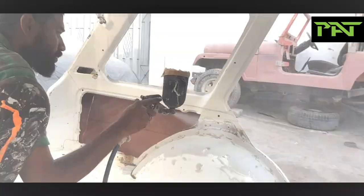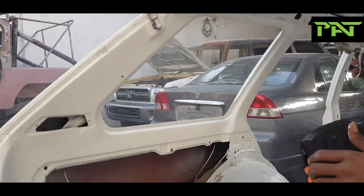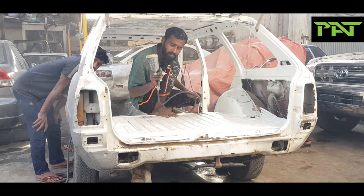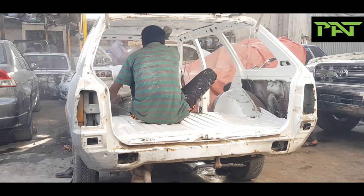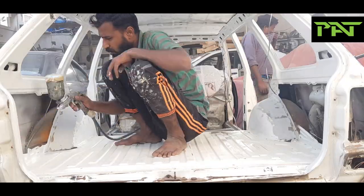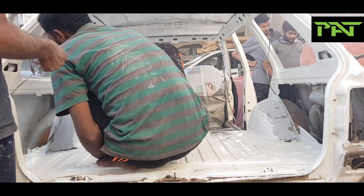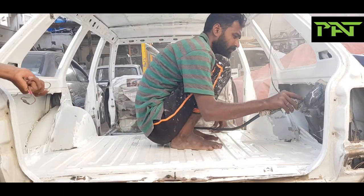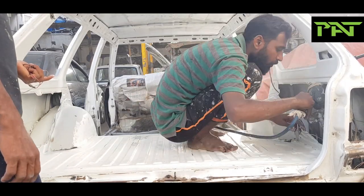With this work, first of all we do the cabin interior, because the cabin is a hard-to-reach spot. The concealed spaces, concealed spots, the roof, the roof belts, and the floor rings — everything is painted beforehand, before we move into painting the actual vehicle from the outside. Rear fenders, front fenders, chassis sub-assemblies, and sub-chassis frames — everything is anti-rusted and then top-coated with body color.